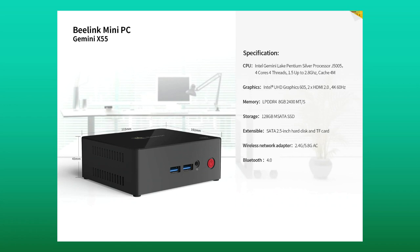And especially as this model also comes with 8 gigabytes, as I mentioned earlier, of DDR4 RAM. Now, many of these PCs, certainly the slightly older ones, usually come with 4, and in many cases only come with 2, and often that would be DDR3. So here we've got the faster RAM, and plenty of it for a Linux installation. 4 is about the minimum really you want these days with a Linux distribution, probably Windows too. 8, I would argue, is ample, unless you intend to do some really heavy lifting on this machine, in which case I wouldn't recommend it anyway because it's not suited for that purpose. But 8 is absolutely ample for the intended use for this type of machine.